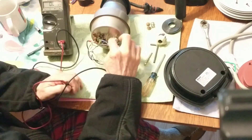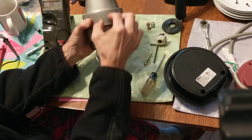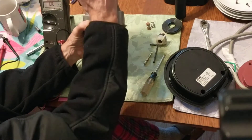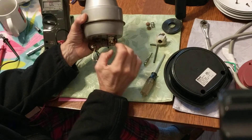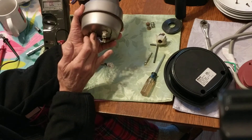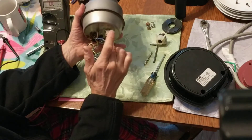When this heats up, the switch will open and it will stop heating — that's how this is supposed to work. The way a kettle works is that once the water starts boiling, there's a small tube at the top that comes down to the sensing element. Before the water boils, the sensing element is closed and the water continues to heat. Once it starts boiling, the steam from the boiling water gets into that small tube, which delivers heat to the switch.